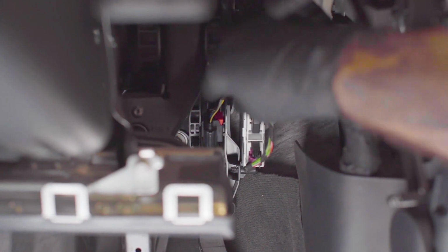With the iDrives, they plug into your existing accelerator cable. Because it's all electronic, what you're going to do is locate it. You'll find the plug mainly on your accelerator. With the Audi, you've got this little red tab. That is just a little locking pin. So you push it up, or unlock it, press, and you can pull it up and release it.